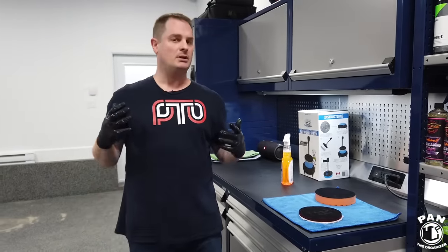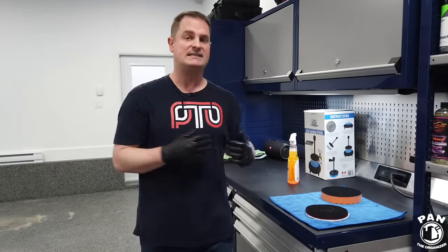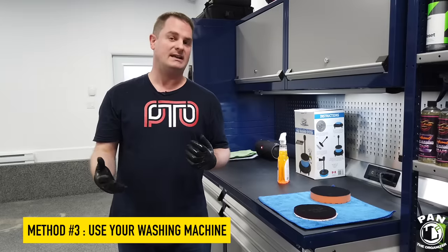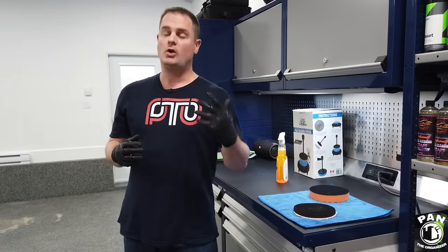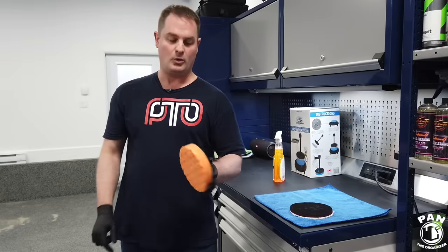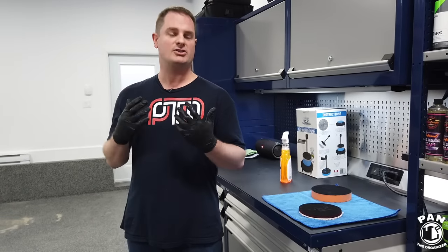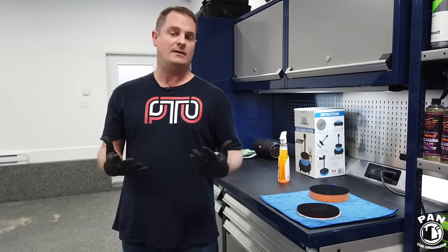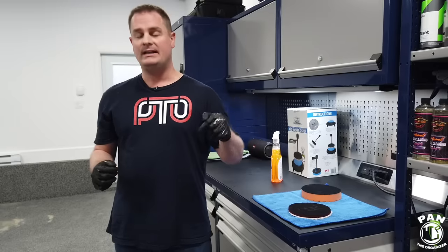Method number three is pretty simple as well. If you have even more pads accumulated in a high-volume shop setting, you can clean your pads the same way you'd clean your microfiber towels — in your washer, if you have one dedicated for car detailing products. Use a gentle setting and cold water as much as possible. Try to avoid super hot water long-term because you don't want the adhesive between the Velcro and the foam or microfiber pad to be removed. Use a microfiber detergent, then air dry as much as possible, or tumble dry on very low heat — or no heat, even better. I have a tutorial on cleaning microfiber towels on my channel, and I'll include the link in the description.